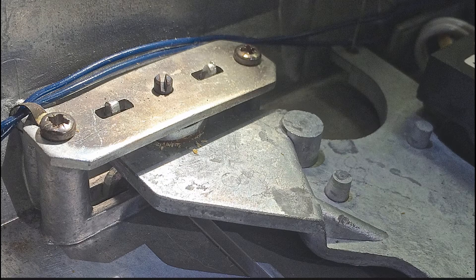This here shows one of the transport locks of the Biogram. Essentially we have a bolt that has two counter-threaded parts, and each of these threads catches one of the washers — one up here, one down. By turning this counter-clockwise, the upper washer is moved down and the bottom washer is moved up, and that locks the chassis into place.